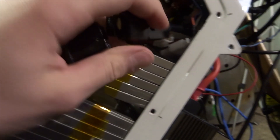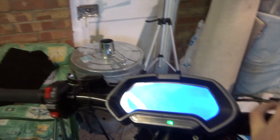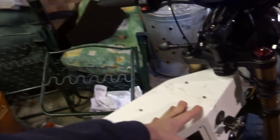What I'm going to do is remove the BMS from the equation by directly connecting the output of the battery to the controller. Now, ignore the fan noise - I think the fan might be a bit dodgy - but you can see we've got high beam, everything, indicators, and if I activate this we've got the dashboard as well with the modes. That's simply from removing the BMS, so something on the BMS - probably a setting - is causing this. I suspect it could be the inrush current.